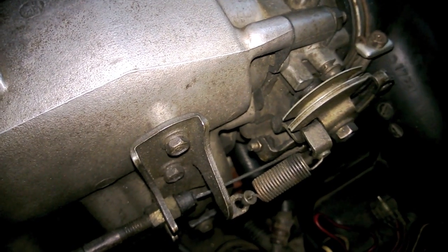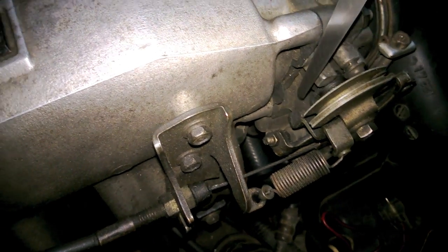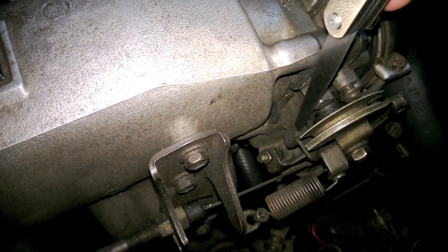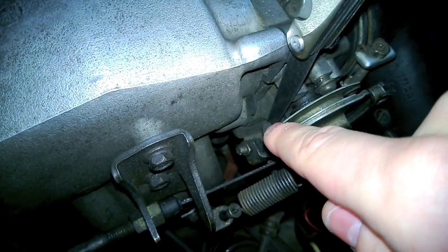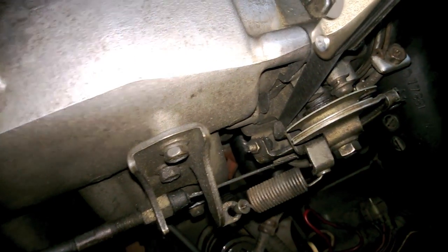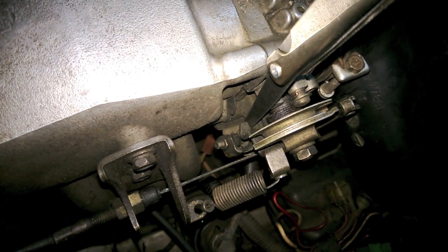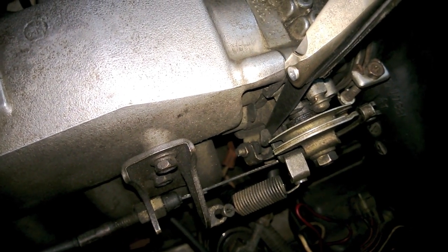In this case you do not place it there. You place the gauge blade on another bolt which is located slightly above this one and it is a solid one. You place it on the stopper bolt that is above that one — it's a smaller bolt. You see, hopefully this will clear out the mistake I made in the last video in the throttle position sensor tuning video.